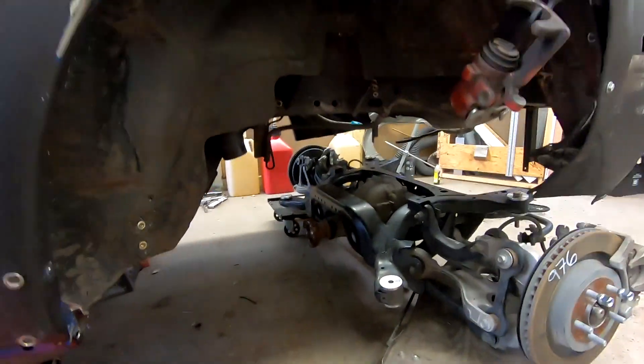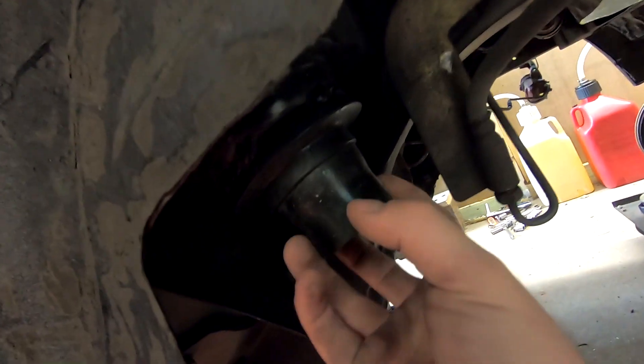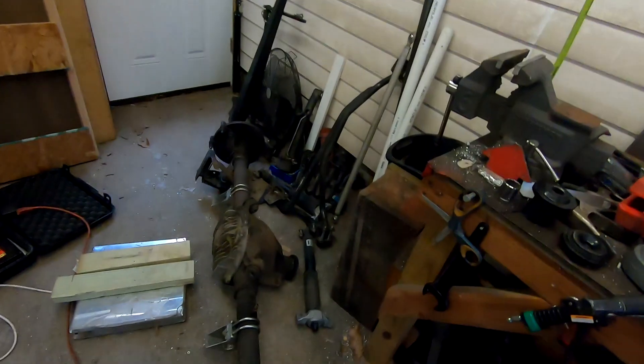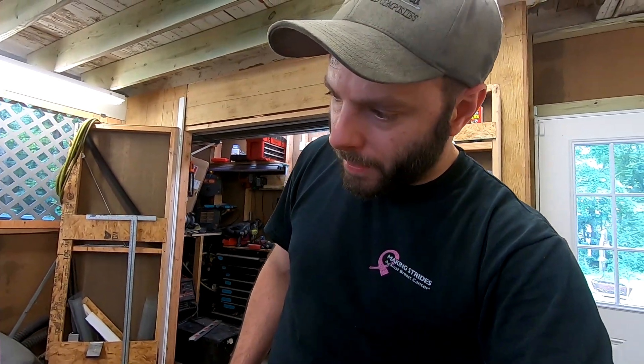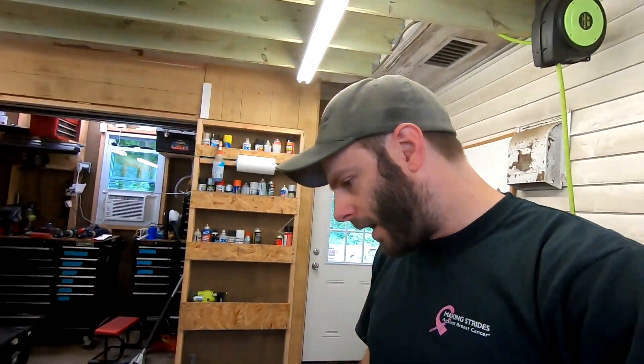With the weights out of the way, we're ready to slide this under the car. I'm definitely going to have to cut off these little tubes — they're add-ons to the stock spring perch, a Maximum Motorsports piece that allowed you to run a coilover spring at the control arm location, making spring changes cheap and more plentiful. I'm going to cut them off because the mount on the subframe is going to be really close to the OEM frame, and the rules say you can't modify the frame or the subframe.